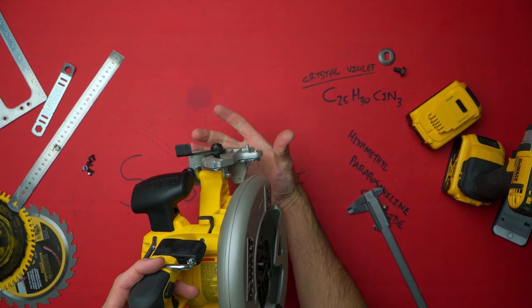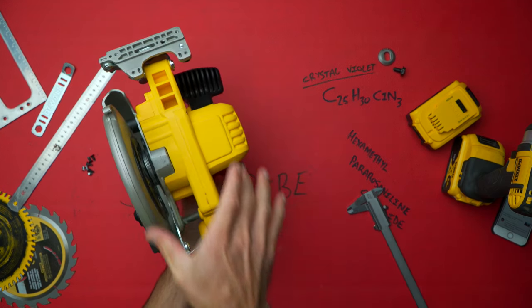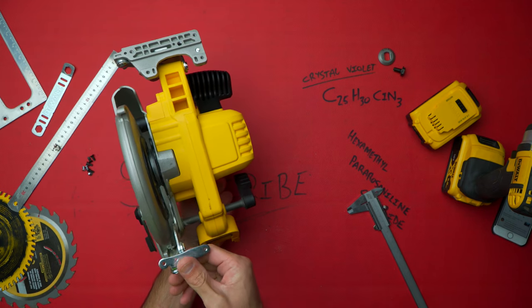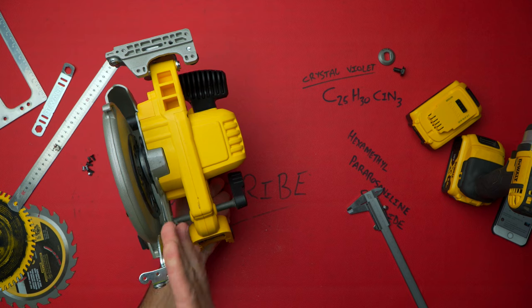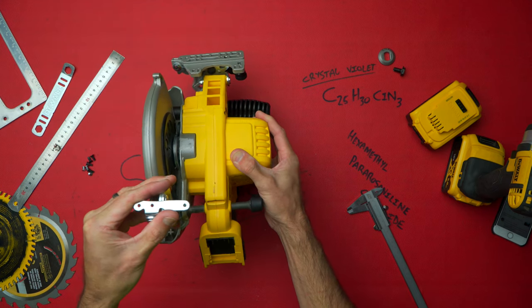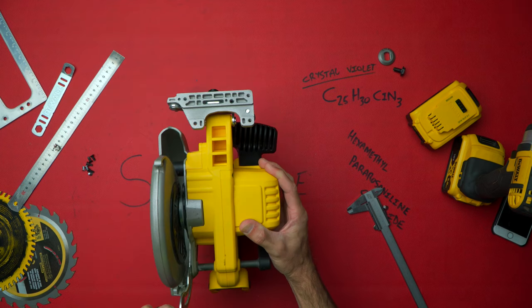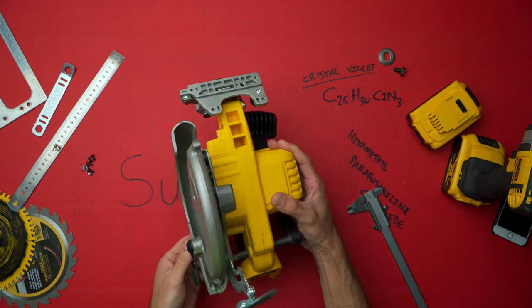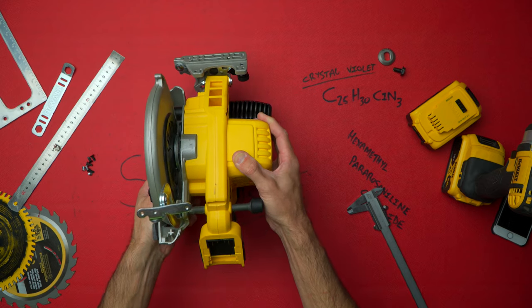All the way from the front it's having to support the back plate. It's got this mount at the back but it doesn't really provide any type of indexing mount or much strength — you can see how flexible it is. So again that might be why you're getting one millimeter run-out on the cuts.